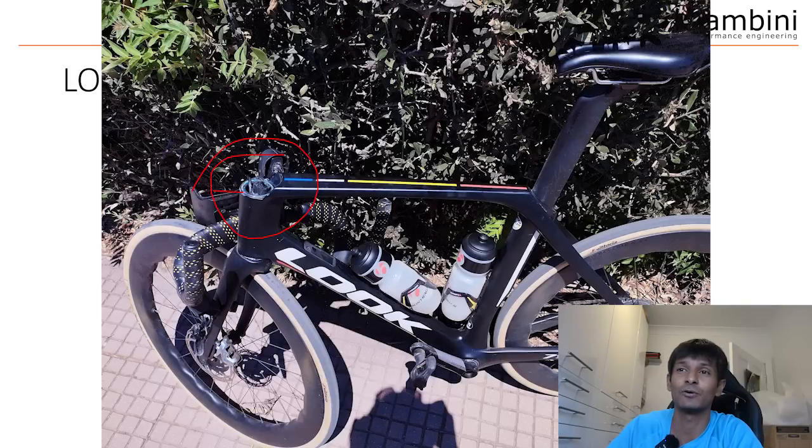It's gone through almost the wedge ring, which loads up the fork, so it preloads the steering assembly, and it has failed there. Now the guy in question probably has to thank internal routing for saving his life and keeping the handlebars attached. So, you know, good advert there for internal routing.